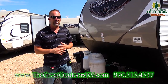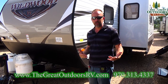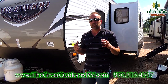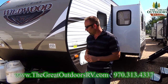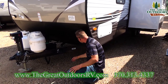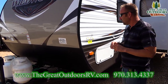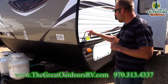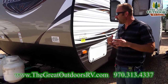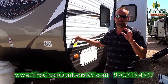One of the things I get asked daily is: what's the camper weight and can my truck pull it? The dry weight is one number and the GVWR is the weight with all your gear on board. This coach reads 6,609 pounds dry weight from the factory — no propane, no batteries, no water. The GVWR is 7,701 pounds fully loaded, so you have about 1,100 to 1,200 pounds of cargo capacity. Make sure your tow rating is at least around that GVWR number to safely pull this camper.